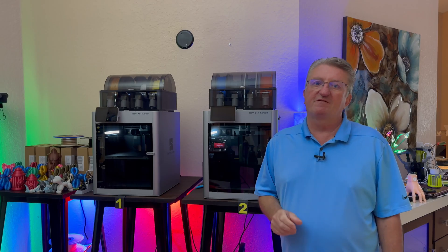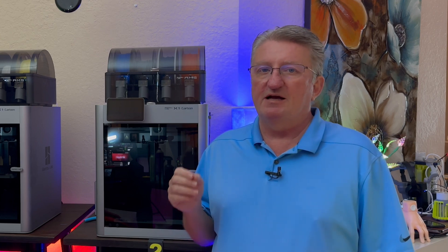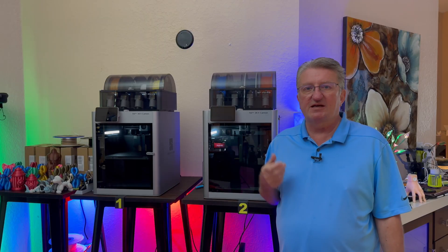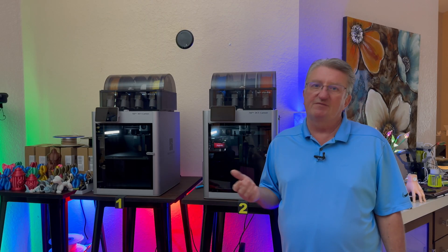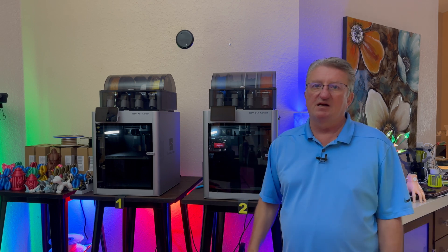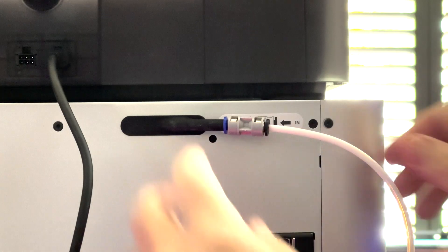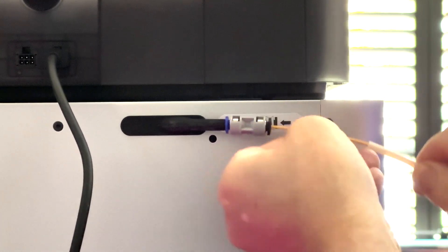This is what I found out is the easiest way to fix it short term. Mostly it happens either when I did a multi-color print or after the print is finished and it wants to rewind the spool — it gets stuck at 99% even though the print is finished, but it just cannot rewind. You push the little ring and release the PTFE tube, then wiggle back and forth. Most of the time that was enough to just loosen it up.